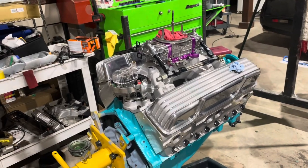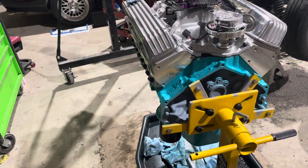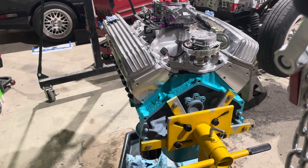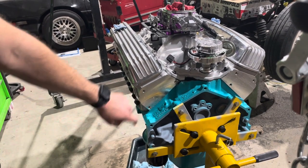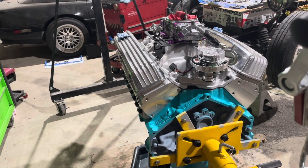I'm trying to get to the finish line. I'm getting ready to mount it to the transmission. Those heads even look good. Yeah, they're Flowtech 1As. They've got pretty good reviews, middle of the pack, not super cheap, not super expensive. Little 202 valves, 64 chambers, so it should be about 10 and a half to 1 compression. Well, 10 to 1? Yeah.